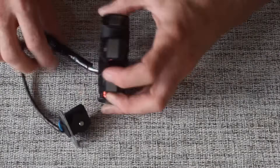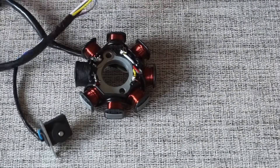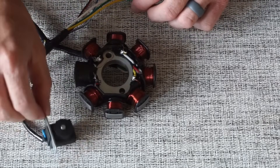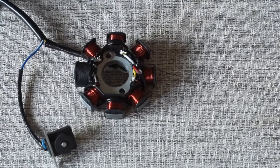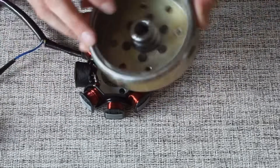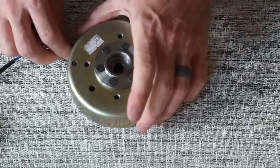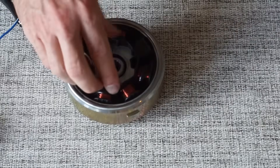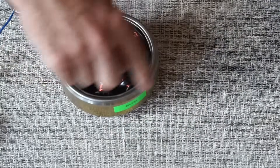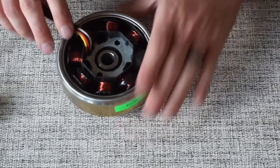Here is a stator. There are two functions to a stator: you have the charging system and then you have the trigger — it's kind of two separate things, or a pickup coil. This is all on your engine, on the right side if you're sitting on it. This is a magneto — it's magnetic and it goes right over the stator just like that. The stator stays stationary on the bike and this magneto spins around, generating a current as it spins. That's how your charging system works, but we're talking about CDI boxes and the ignition.